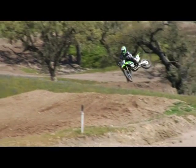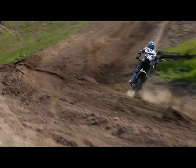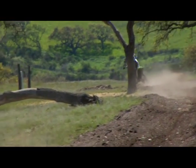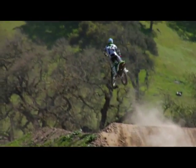Out on the track, I went out there and had everything in the middle. It felt initially a little harsh on some of the smaller bumps, so I backed out the bottom-out clicker all the way. It helped with that, but it obviously didn't help with bottoming resistance. So I fooled around with the clickers a little more, added some more bottoming resistance, added a little more compression, and got the thing pretty dialed in to where I like it. I'm going to try racing on it and see how it goes, but this is just an initial taste. If you want to find out more after fully testing this shock for a month or two, check out the next issue of Transworld Motocross.